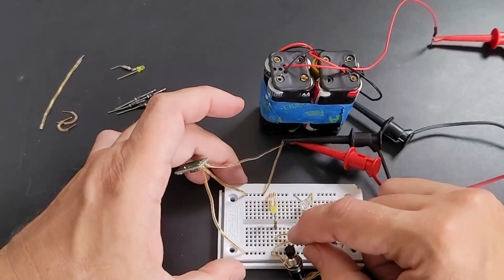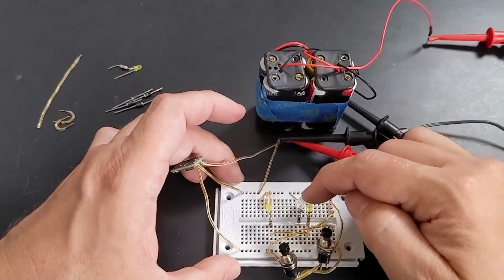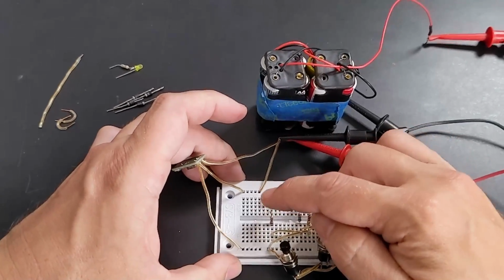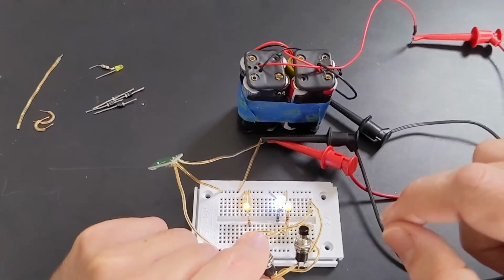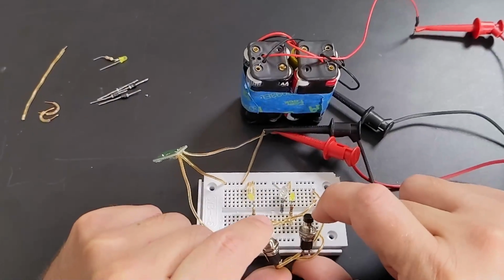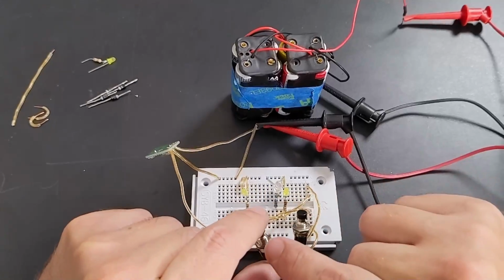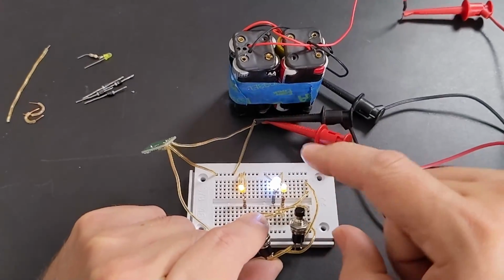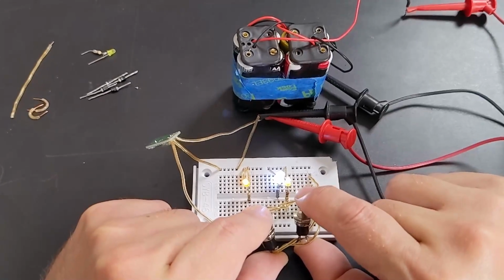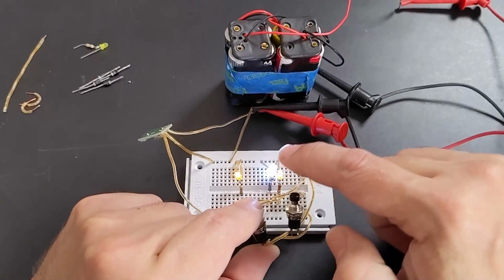All right, so let me connect the blinker as well to that same side marker light. So both of these lights now should send a signal to the side marker light. So let's turn the running lights on. Hey, look, all the lights come on. Now let's turn the blinker on. Look, everything blinks. If I turn just the running lights on, they come on and they stay on. That's awesome. That's what we want. But if I turn the blinker on, nothing happens. It just stays on constantly.